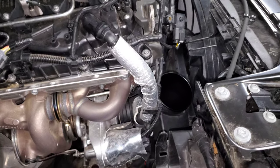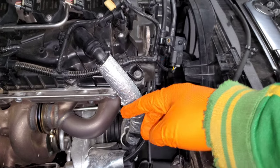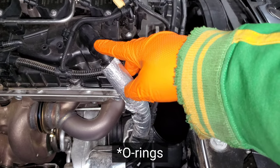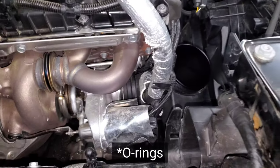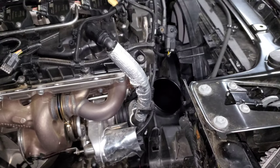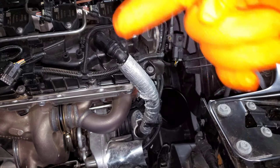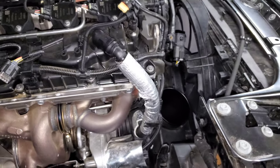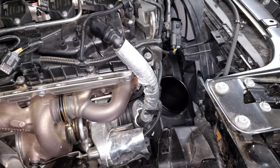This specific check engine light is indicating that this hose is leaking — either there's a crack in it or there are gaskets around the connections and potentially airflow could be leaking past those gaskets. Because it's an emissions requirement to have your crankcase gases recirculate back into the intake, if it senses that it's losing air there it's going to throw a check engine light.